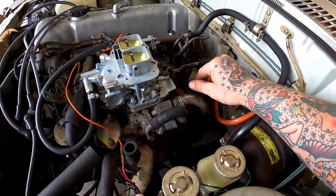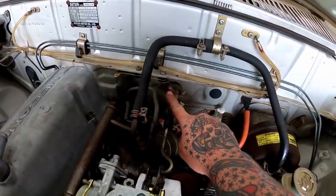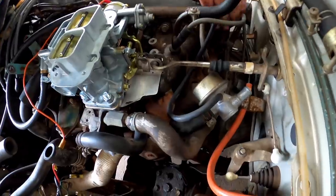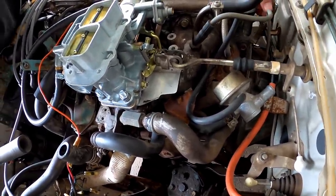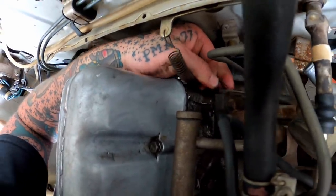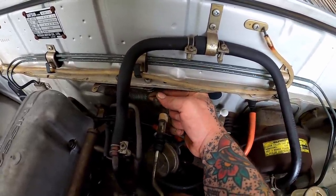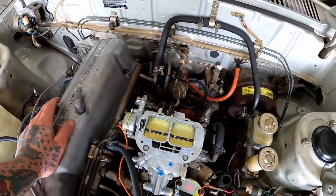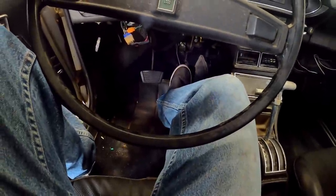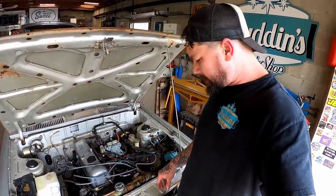And we need to throw a spring on here. Where is the easiest place to put a return spring? He said right up there, 10 points. This current spring is going down to absolutely nothing. There's a bracket there, but I don't understand what it's supposed to be doing. There's no reason to have a spring on this. Now, surely this was supposed to go over here from the factory. Makes sense to me anyhow. Now let's give her the old foot test. There we go, that feels better. All right, we got some throttle going on now. Choke. I think we got her all going.